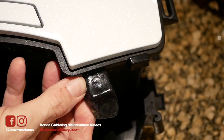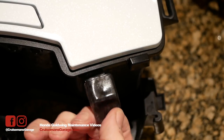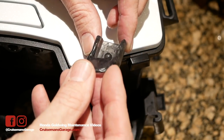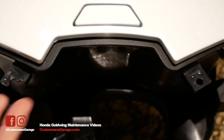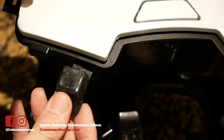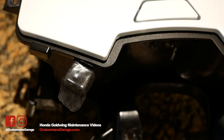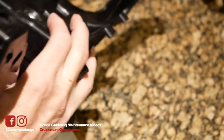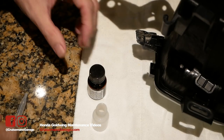It's been about 10 minutes — let's see if we can release this mold. It's still soft and rubbery. There's my mold, and it looks like a pretty good one. So we're going to transfer this over to the cracked piece and see if we can get that to go on there. I'll turn this upside down, put some towel down so I don't damage my paint, and we'll look at it from the bottom. We've got a pretty good fit.